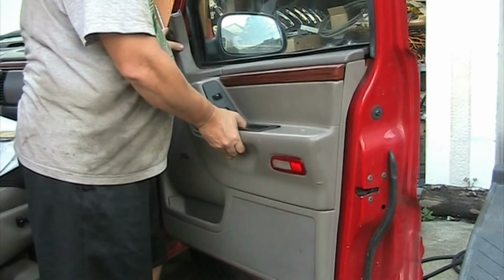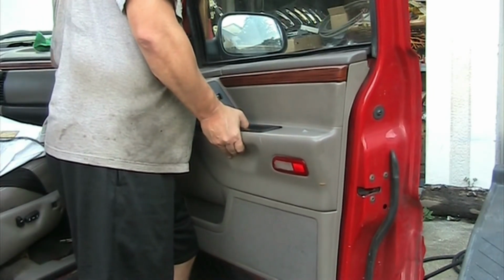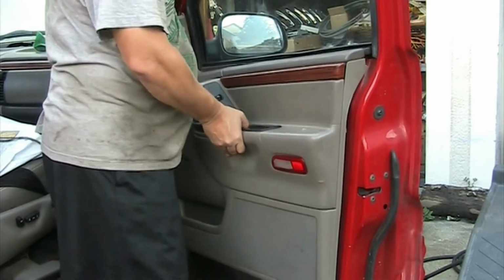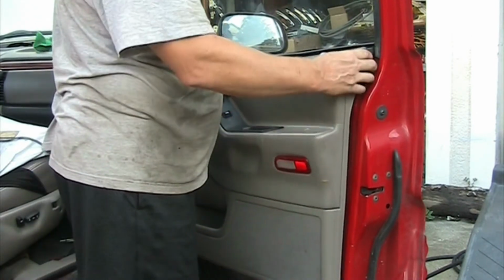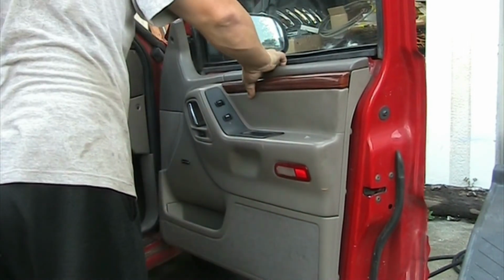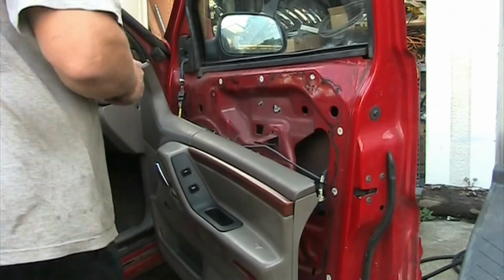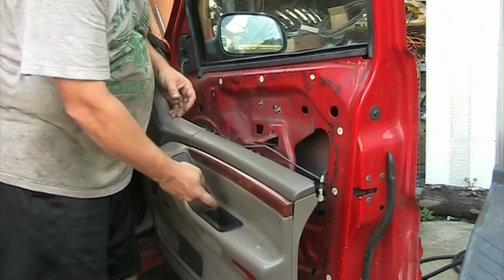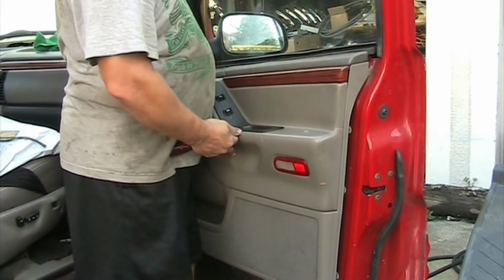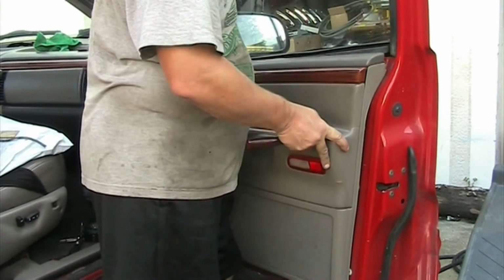And you have your pins back on. And now we should be able to pin this door panel back in place. I only do it temporary right now because I still have to get all the brackets. So this is the crucial one. It's a one here in the center. Once that one lines up, everything else lines with it. Make sure.